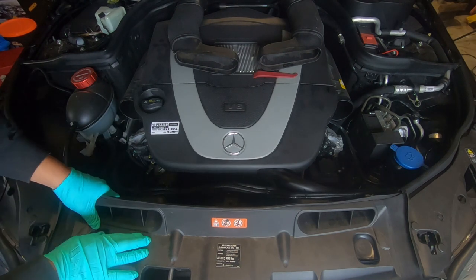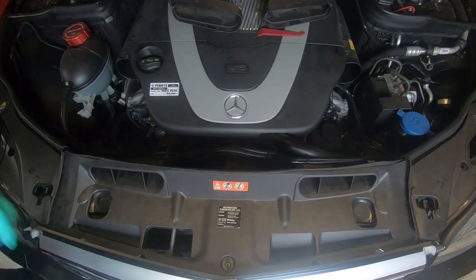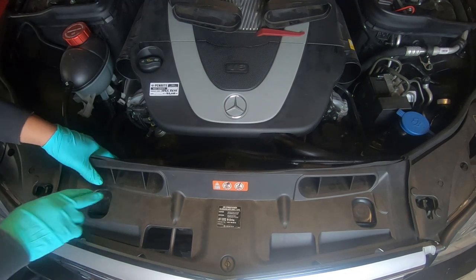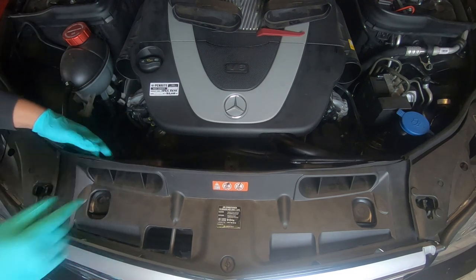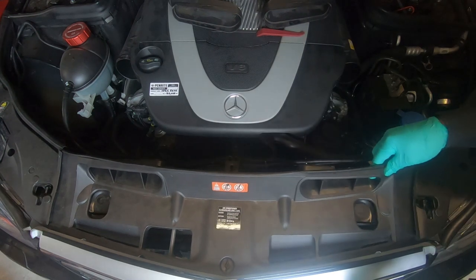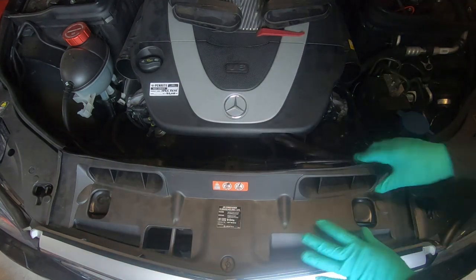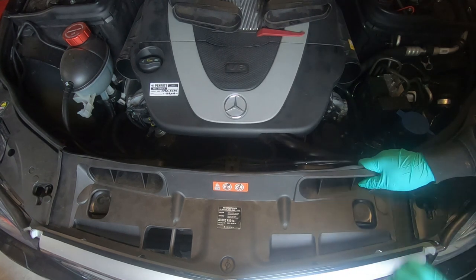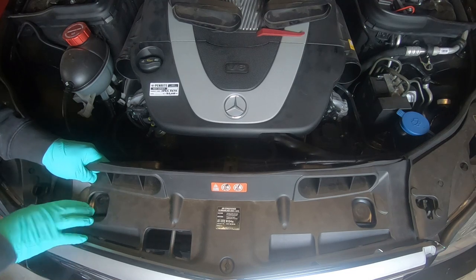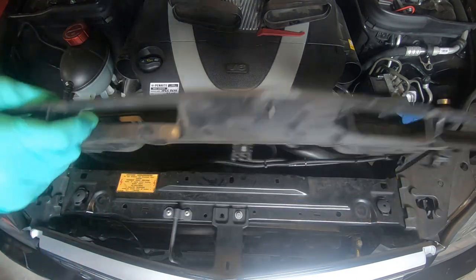You can now begin to remove your top radiator cover. You're going to see a twist-out right here — horizontal locks it in and vertical removes it, so you just have to turn it vertical. At the back here you're going to see clips. Pull it back enough to release the clip from the top radiator support bar. You do the same to the other side — pinch it so it releases from the clip, then lift it up. There are two more clips; push down and towards the front of the car and it will release. That's your top radiator support bar released.